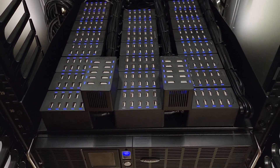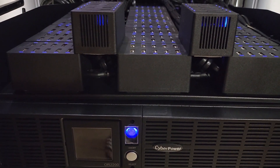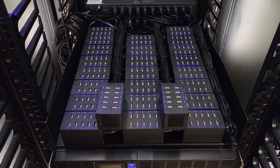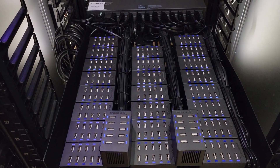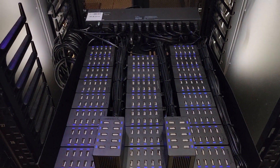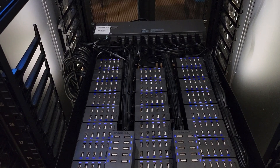It has a battery backup capable of sustaining 1380 watts. It'll run this entire system for about five minutes at full load. I don't expect to run it at full load — I expect to run it at about a thousand, maybe 1100 watts max. Remember, guys: the 80% rule — always with electronics, maintain an 80% load buffer.